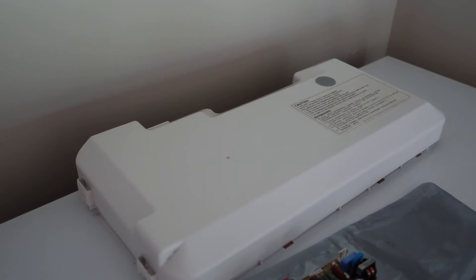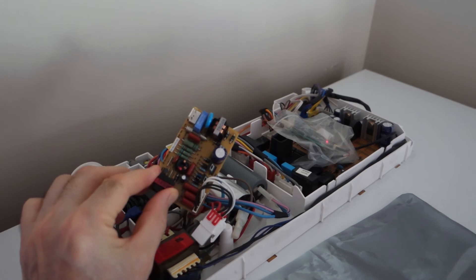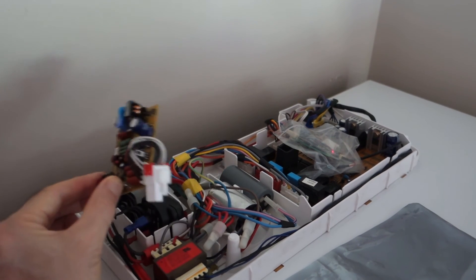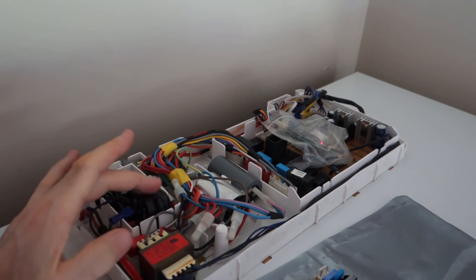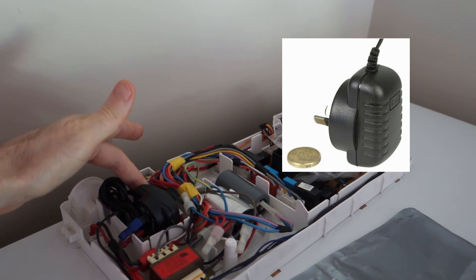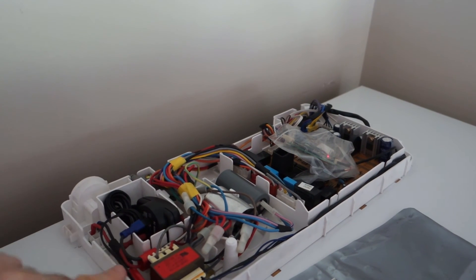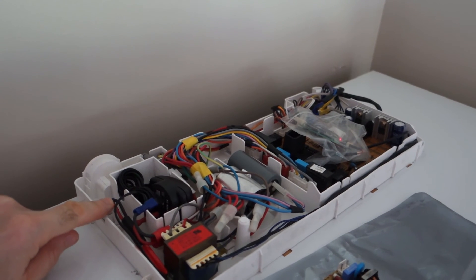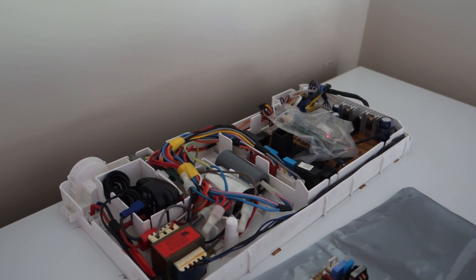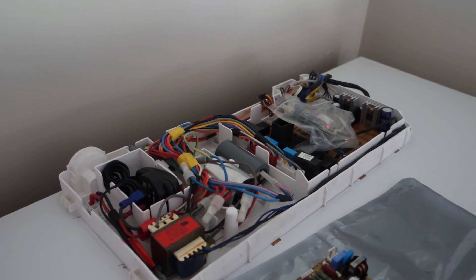So here we are on the top of the fridge. I'll just pop this cover off, which I've previously unclipped. If I hold this up, this is the original inverter board which converted the 240 volts AC up to high voltage DC for the fluorescent tube. I've removed that — it was located here — and replaced it with effectively just a very simple wall wart, like what we normally use for running LED strips. It just converts down from mains to 12 volts DC. These wires here are carrying the mains, and the red and black wire here carry the 12 volts out through the body of the fridge to the LEDs. A very simple hack — it's been running for a couple of years with no problems. Hopefully it will run for the rest of the life of the fridge and I won't have to buy any more of those expensive fluorescent tubes. Thanks for watching.